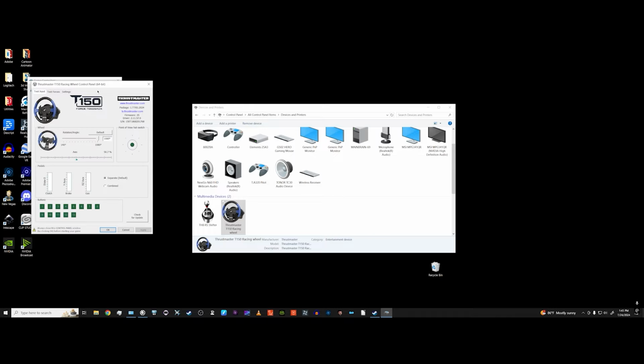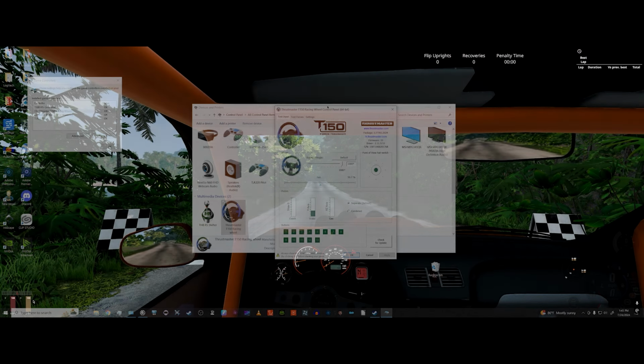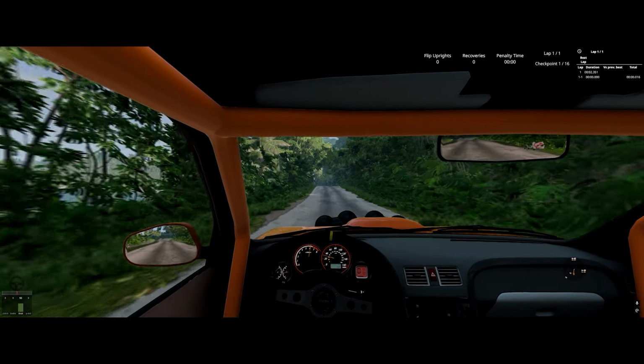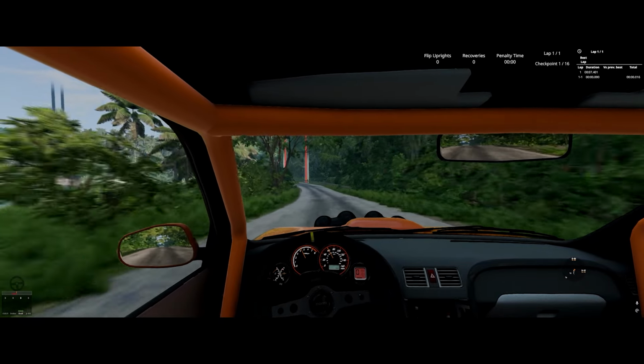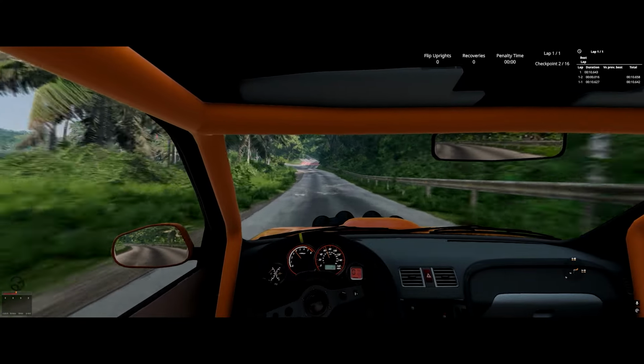You can confirm this by firing up your Thrustmaster wheel software and checking the brake input directly. If you're able to move your brake pedal very much without seeing any change to your brake signal, this is a problem. In my case, I was able to depress my brake by about 3/8 of an inch before seeing any signal change. This is way too much for effective brake control, and there's no way to fix this via software. This problem is due to a manufacturing defect.